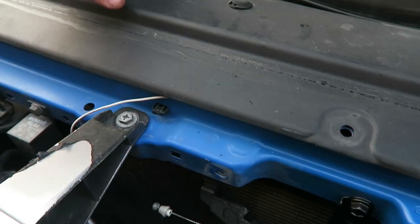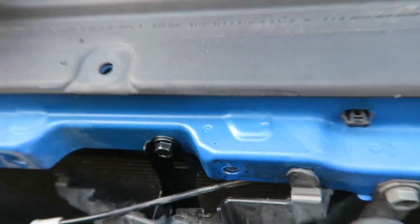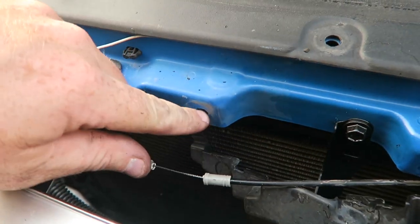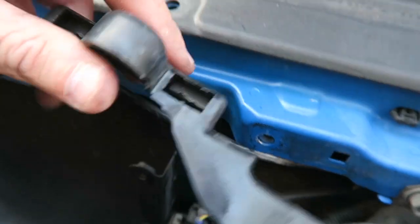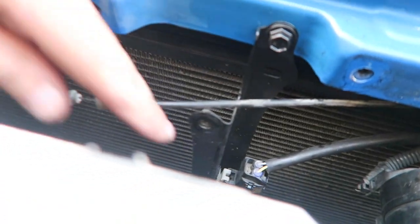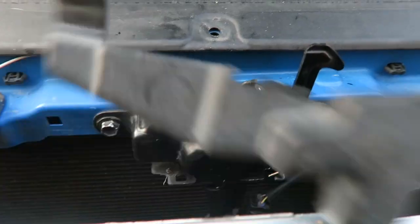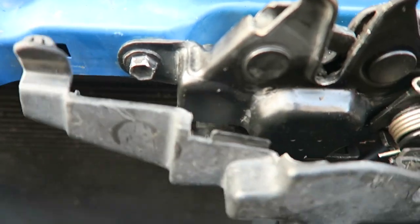This broke right here and it must have come out of the slot. That's how you get the thing out — I had to use the wobbly and the extension to get this bolt out going through the grill, and then from the bottom I had to pry this piece back using my gear wrench and a flat blade screwdriver because there's one bolt right there. I've just zip-tied it back, and this little plastic cover is what was causing me so much grief because it was covering up the third bolt on the bottom.